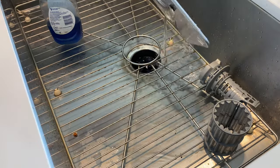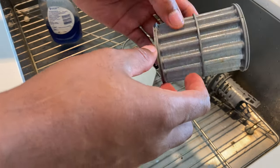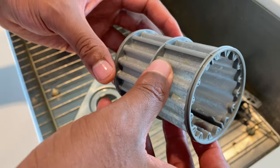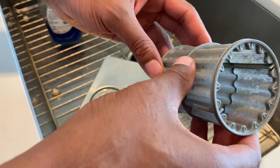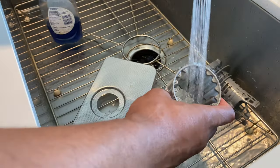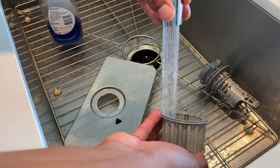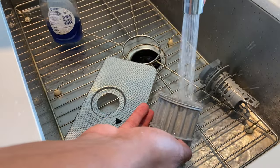Next is the actual cylindrical filter. If you look in there, there's a lot of food debris. If too much gets clogged up in here your dishwasher will not function properly, so you want to clean this off. I take some warm water and spray it down — generally if it's not a lot of mess the food will just fall off. Make sure you get both sides since food can get caught on both sides.